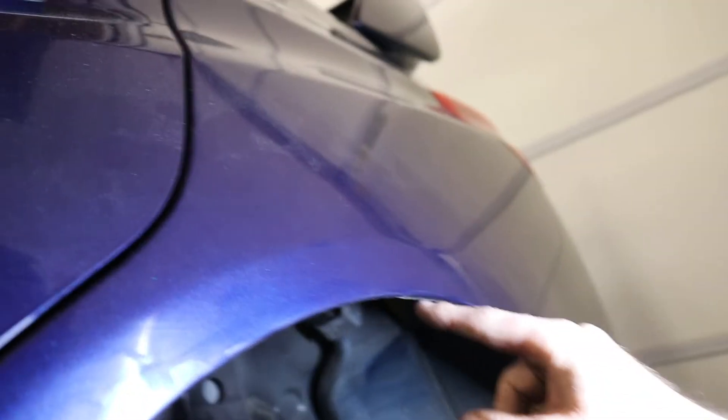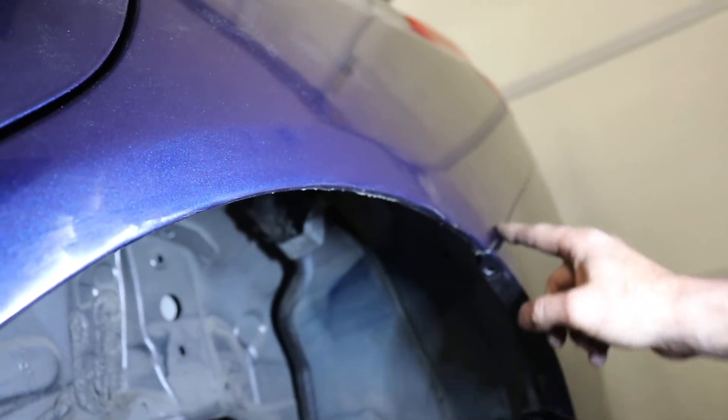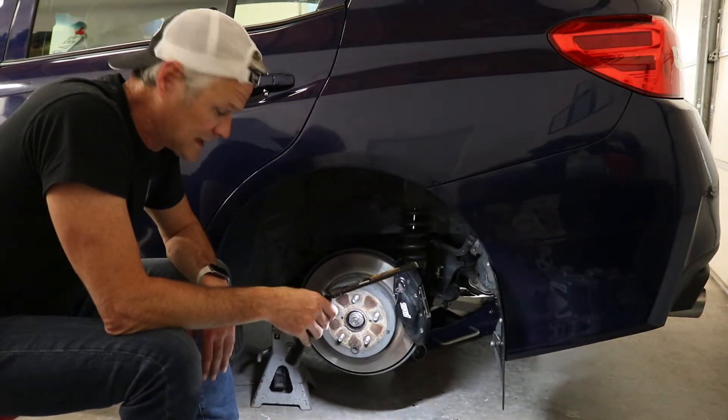You can really start to appreciate how much it kind of pinched in — the gaps at the tops of those slits show you how much harder it would have been without them, because that metal wouldn't have been able to expand like that. My rubbing problem is going to be about as good as it can be now. Right here I start getting just a little bit of cracking, and down through here this is Bondo where I patched some rust on the fender — so that's not surprising. The rest of it up to the front looks fine, but close to the Bondo it just doesn't flex like the paint and metal do. Now let's throw the fender liner back in and slap the wheel back on to see how it fits.